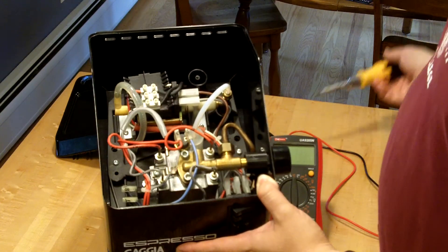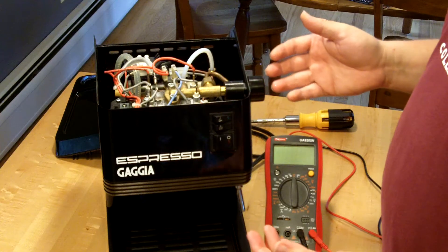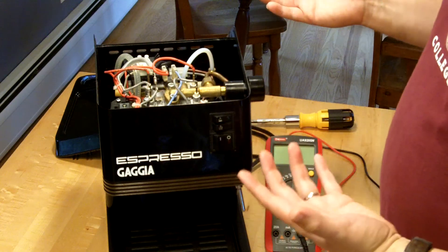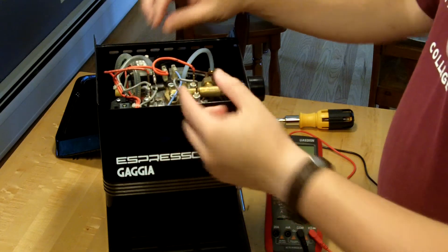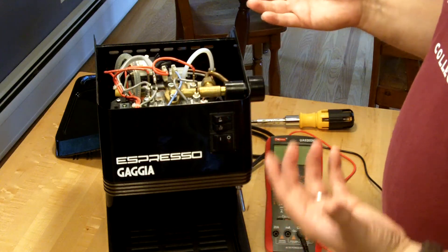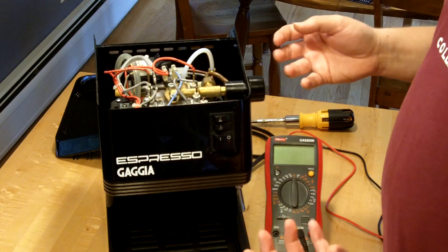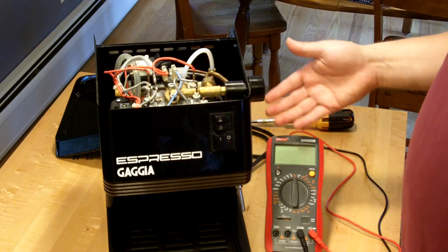We want to make sure the brew thermostat is still working properly. It's a really simple temperature-based switch — basically a closed circuit at room temperature, and once the temperature rises above a certain amount it opens and won't pass current anymore. The other part is this bit right here, called a thermal fuse or thermal protection link. It's basically like a regular fuse, but instead of detecting an overflow of current, this fuse detects an overflow of heat. It runs fine and passes current most of the time until it's gotten overheated, and then something melts inside it and it won't pass current anymore.